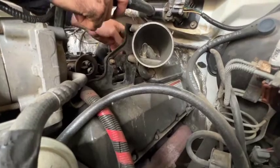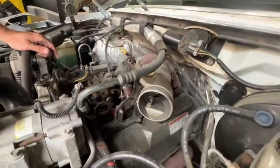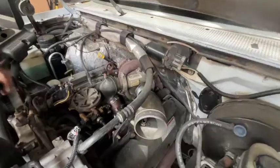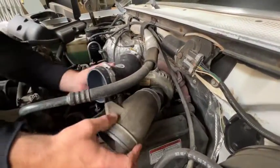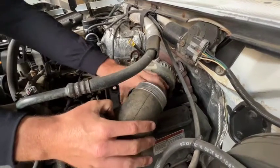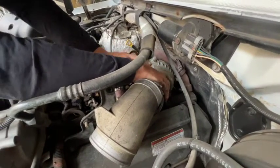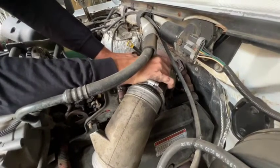Now we're going to get our surfaces cleaned — spray it down with some brake cleaner — then we'll install the new boot going from the turbo to the casted intake pipe. Now we're going to install the SMB intake pipe. We'll pull the cast pipe away and get this pushed on to the turbo. Looks like it might have had the hose clamp just a little too tight.